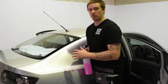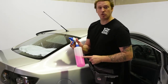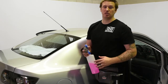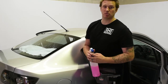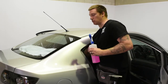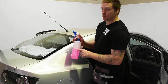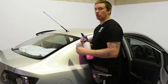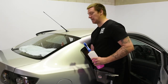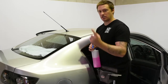Okay, so now we've got the rear screen film off. You'll notice it does leave a bit of adhesive, so we're going to get adhesive remover or dissolver. The best advice is to speak to your manufacturer or distributor — chances are they're going to have a chemical that works right for you. I'm going to spray it on lightly. I've got a drop sheet down so I don't damage the car at all, and I've got my steel wool. For best results, spray the window, wait a couple of minutes, give it another spray, and really give it time to eat into that adhesive to make it easier to remove.